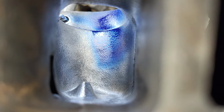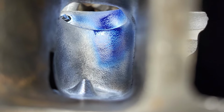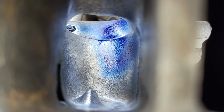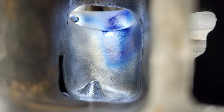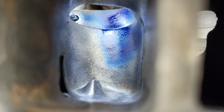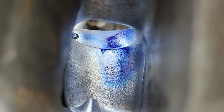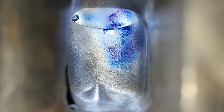Okay, you can see the absolutely enormous bowl on this. And only because it was a special request, we're gonna do some clay action after this. We're gonna fill a good piece of that bowl, and I'm willing to bet it'll work better. It's interesting now that there's no guide restriction whatsoever. And the blue still doesn't go to the roof, and our roof speeds are pretty sad. So what does that tell us? It's probably too big, right? You know what? Sometimes too big really pays off at the upper lifts, but it doesn't make a big old fat curve, and you know how I am.